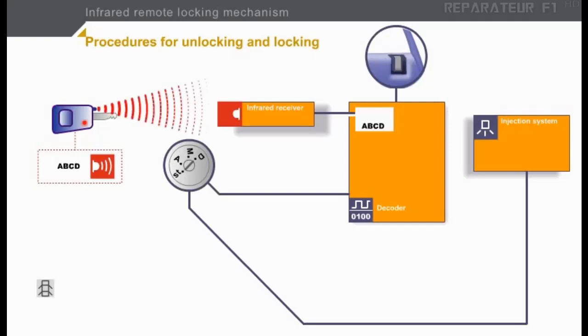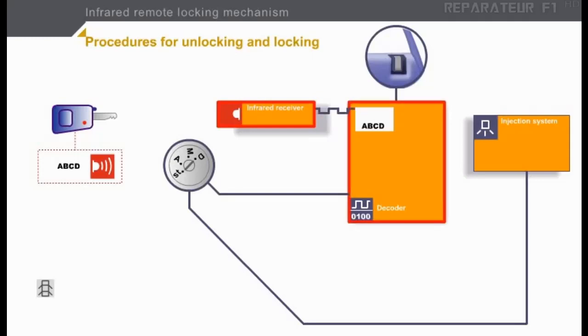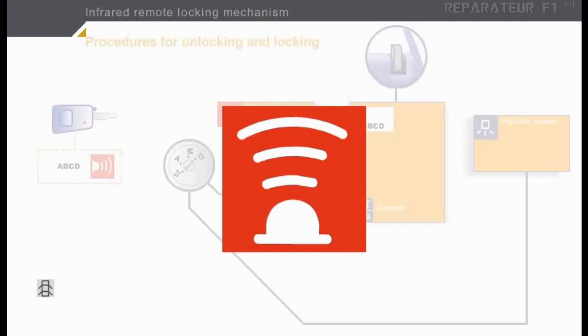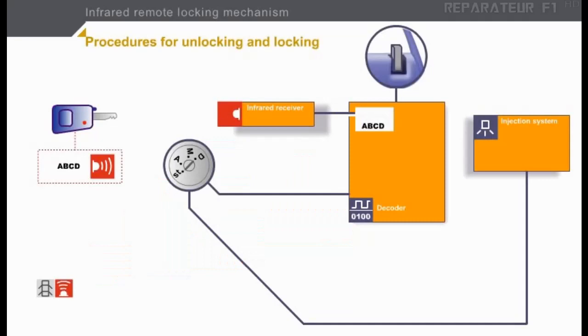When the remote control command button is pressed, an infrared signal corresponding to the code is sent by the transmitter. The receiver receives the infrared signal and converts it into an electrical signal. The electrical signal is sent to the decoder. The decoder converts the electrical signal into a code and compares the code received to the one held in its memory. If the two codes match, the decoder instructs the doors to unlock. The driver can open the door and get behind the wheel. This picture represents the infrared signal sent by the key to the receiver. The process is exactly the same for locking the doors.